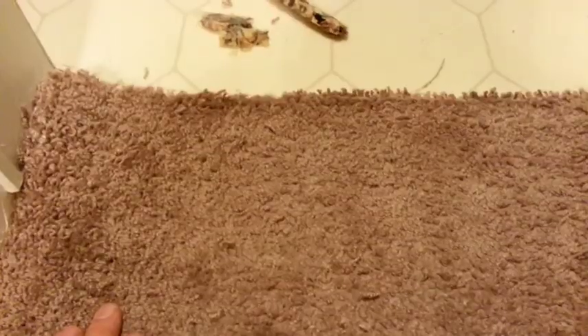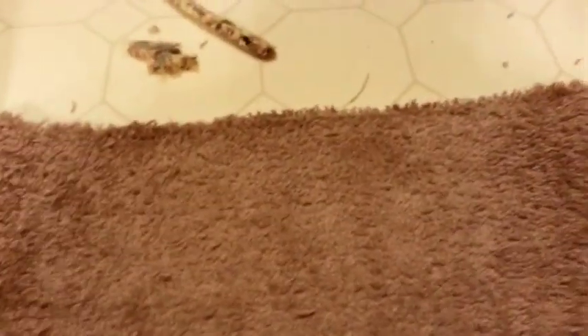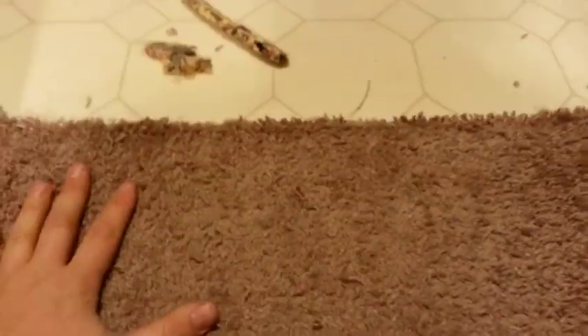When you are done with all this and you're ready to install your carpet and attach the liner back like it was — the problem is when those liners are installed they hammer it down, and there are little nails here. As you can see, some of them actually went all the way in. What you need to do is grab a sharp flat screwdriver and try to get them back up — as many as you can.